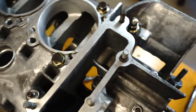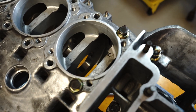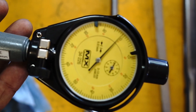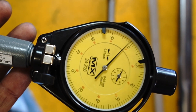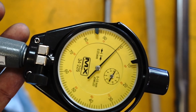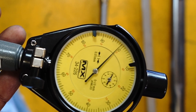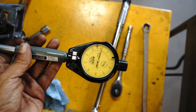The results are in. I've installed through bolts on the actual number seven journal and on the one just beside it as well, just to stabilize the case. So that's in millimeters — that's metric. I've got 0.01 greater clearance, so it's not quite half a thou, but that's very measurable. I also installed a second set of through bolts to see if it made a difference — still at 0.01 of a millimeter.